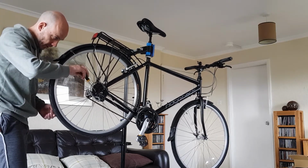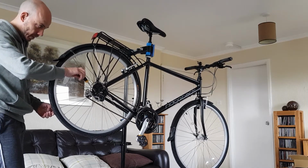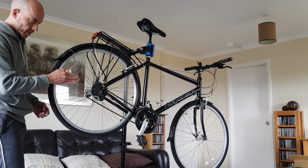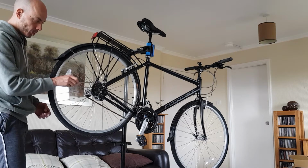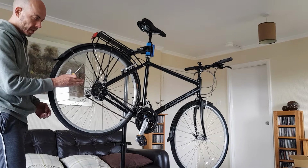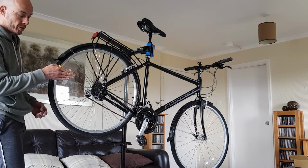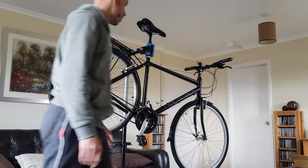And if I tighten that in, I can actually see the derailleur moving across. I'm just talking about a quarter turn, just to move it across fractionally. If I turn that any more, it's going to move the derailleur almost directly in line with the small cog, and quite often if you do that, when you take it out and cycle it, it will be very lazy when it's changing onto that cog. So in my experience, it's good to leave it just a millimetre beyond that cog, but not any more.